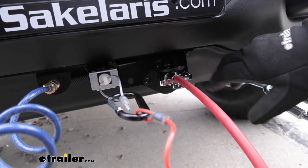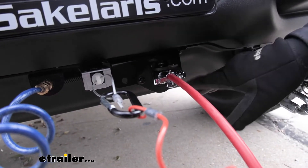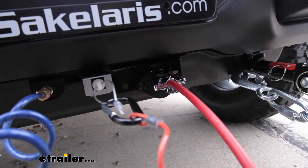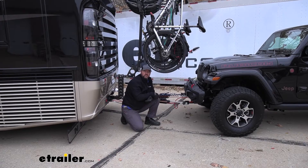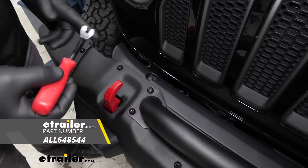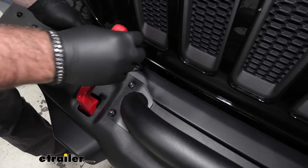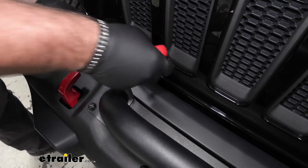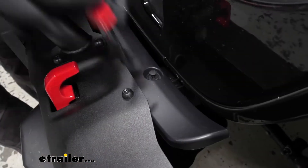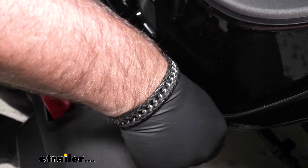What the wiring bracket does is allow you to utilize the same holes that are holding your rock guard on without having to drill new holes — it's going to directly line up with two of the bolts holding it in place. Now that we've gone over some of the features, let's walk through how to get it installed on your Jeep. To start our installation, I'm going to take a trim panel tool. We're going to have a push pin fastener here and one on the other side. We're going to pry up the center, pop it up, and pull these out.